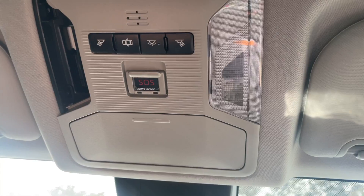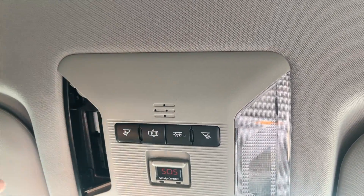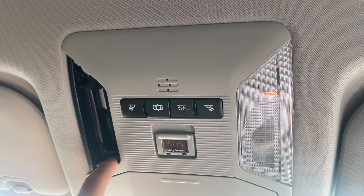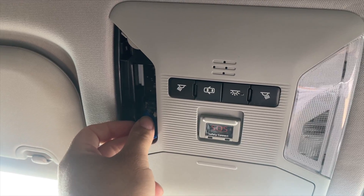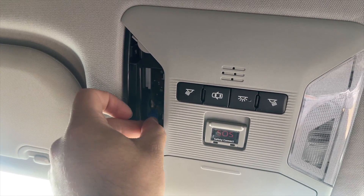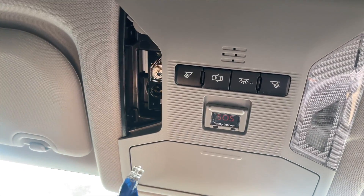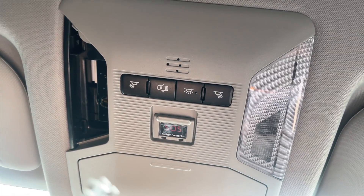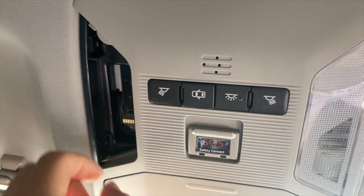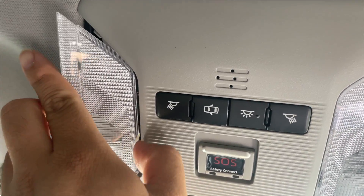These map lights are so difficult to do. I had to watch a couple tutorials on YouTube because some of them are removing the whole trim piece, but it's a different trim. This one is a 2019 LE, so I just removed it from here. Another tip: sometimes these bulbs are hard to grab because they're super slippery and small, so you wrap some tape around it and then you can pull super easy. I learned that when I was installing lights on my Lexus. Just put the LED in and then do a test to make sure it works.